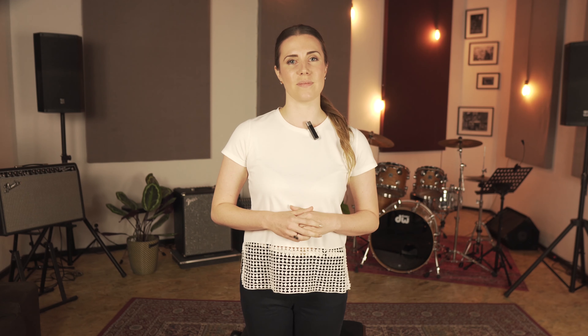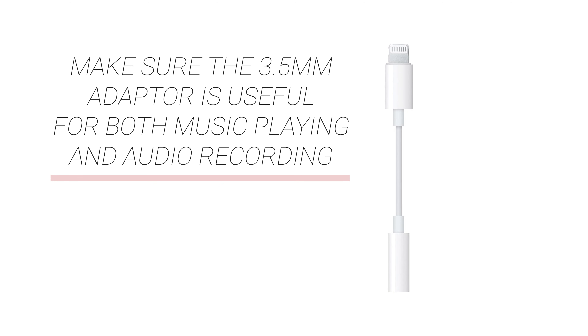The second important note is that most mobile phones do not have a 3.5mm jack. For example, the iPhone requires a lightning to 3.5mm adapter and Android devices require a USB-C to 3.5mm adapter. Some brands provide official adapters when buying mobile phones, most of which can be used. But if you want to buy a third-party adapter, you must pay attention — this adapter must support calls. There are many adapters on the market that only support listening to songs, meaning they only support sound output from your mobile phone but not the input of external sounds, and these adapters cannot be used. Please pay close attention when buying a third-party adapter.